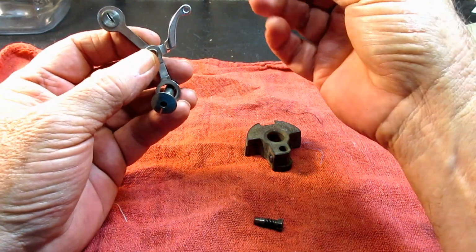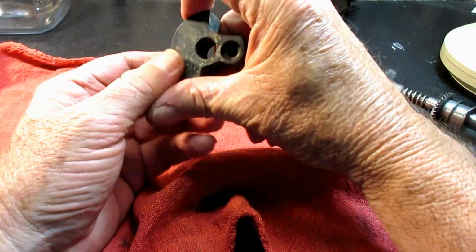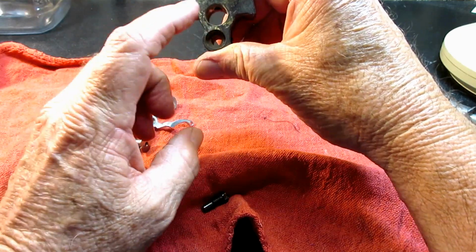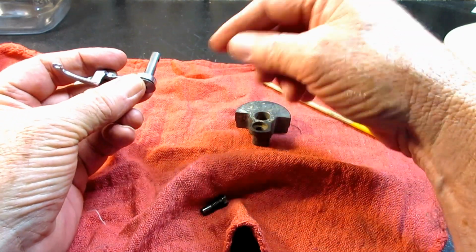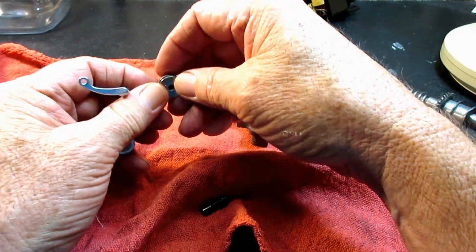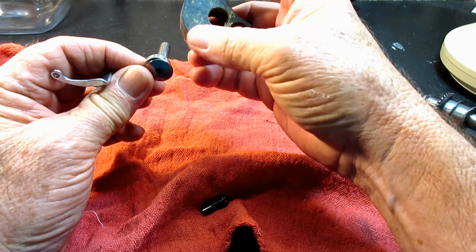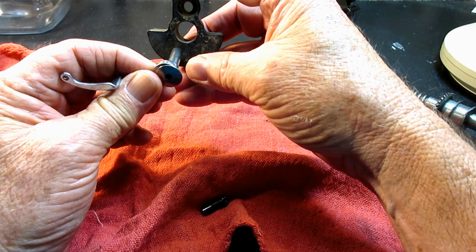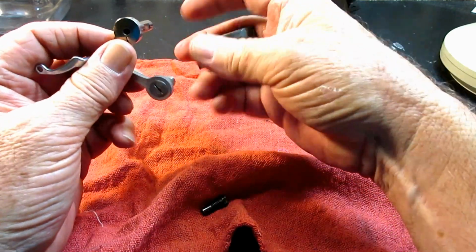And the main arm shaft and this counterbalance, when it turns, it's in a way timed with the needle bar and the hook, because this link that would go on here to come to the needle bar controls the up and down movement of the needle bar, and in my opinion it's timed with this counterbalance, because that's attached to the arm shaft, and that's why it's timed with the hook. So the needle bar and the needle point was perfectly timed with the hook.